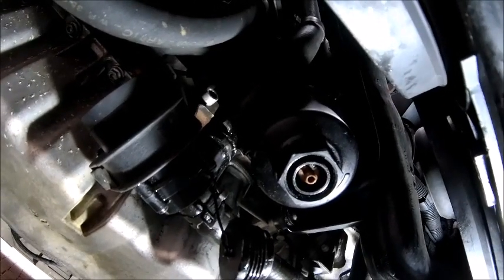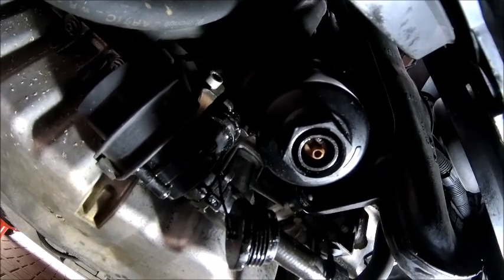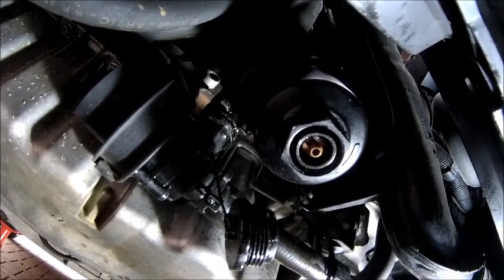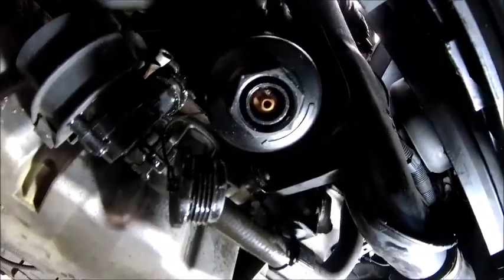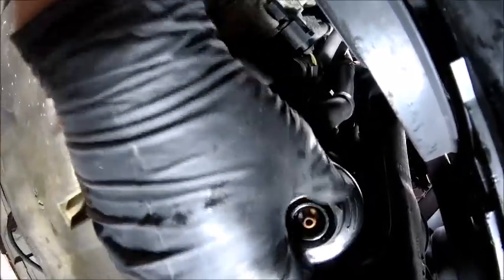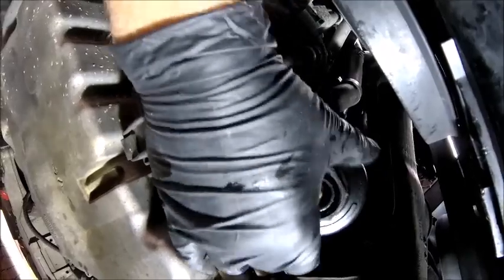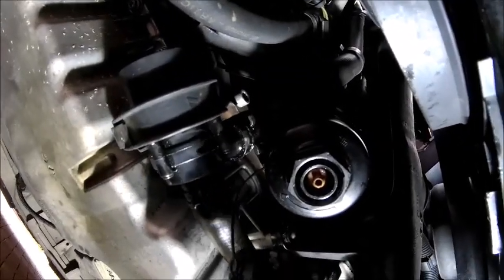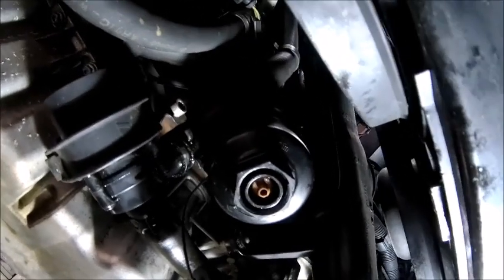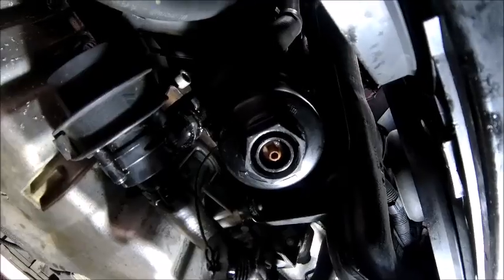So take your time. Okay, if it feels like it's tightening up at any point in the first two or three screws, then take it off, because you're starting to cross-thread it. It should go on really, really easily. So you get it up there, gently tease it in place, and then you should be able to screw it on with your fingers almost to the point where it needs tightening up with a socket. Okay, it's as easy as that. If you feel any resistance whatsoever, don't carry on, because you will be cross-threading it. There you go, top tip for you.